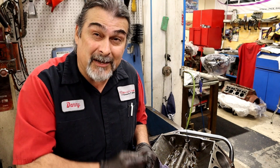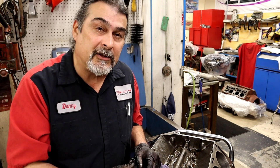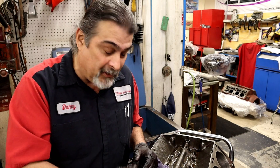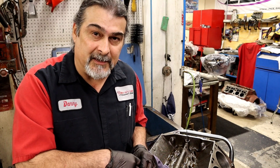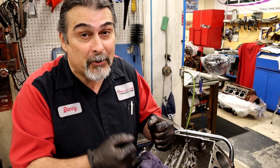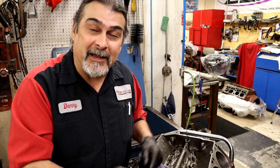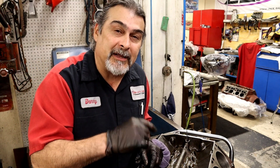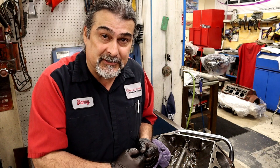You may have sent this out to the shop and they may have forgotten something. You assemble the engine and you can't go back to the shop saying you got scratches on your bearings from the oil galley. The engine assembler's responsibility — I encourage you to partner with a good shop, but I'm here so I'm going to brush these. Don't rely on somebody else to look out for you. Be proactive. Do this yourself.